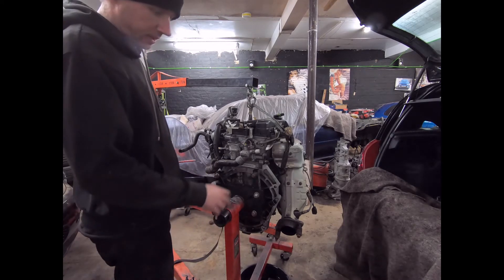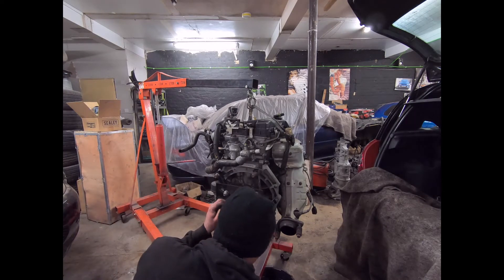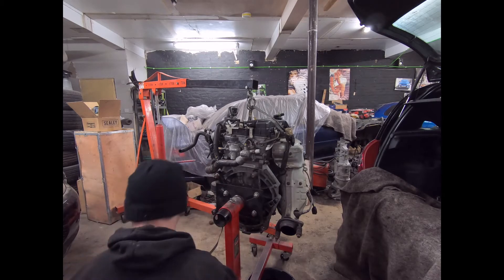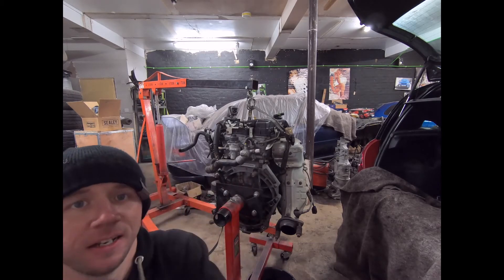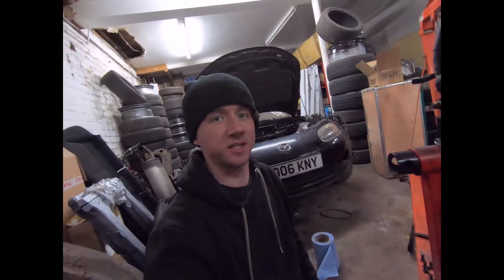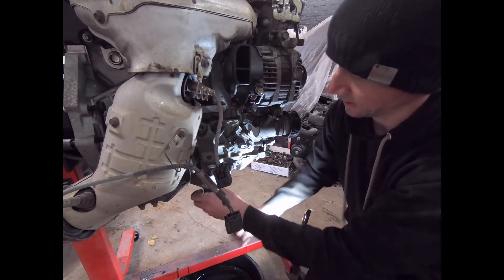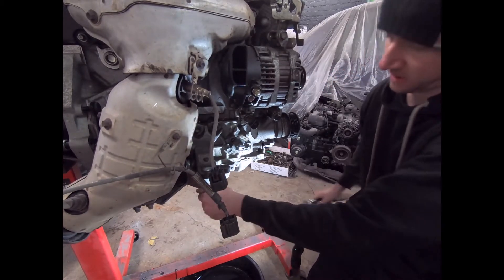When I took the flywheel off, the oil comes out there anyway — I kind of forgot about that and wasn't prepared for it. Let me show you this — it isn't pretty. This is just the first bit that's leaked out of the holes, and the camera might struggle to pick this up, but it's quite shiny. There's a lot of metal in there, and that's purely what dribbled out of the little crankshaft bolt holes. I'm going to move the engine crane and drop the full oil to see what the rest of it's like.